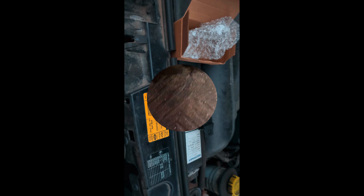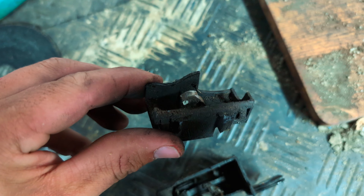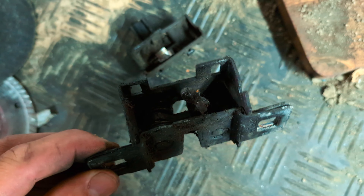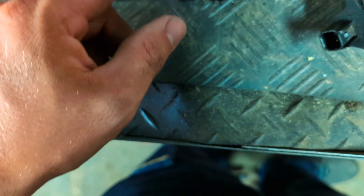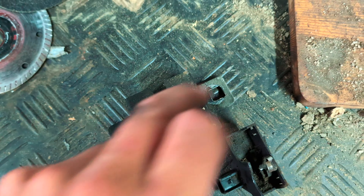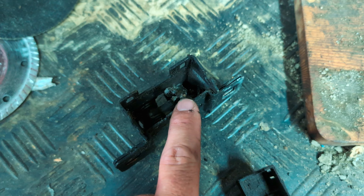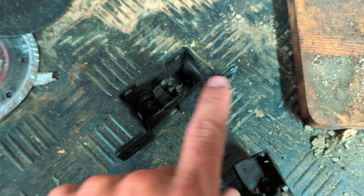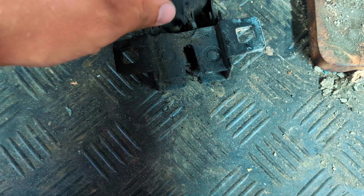Nice quick simple video. The switch fell apart in my hand as I took it apart, so there's no problem there. It literally is just as simple as undoing those two Torx bits, flipping over the cable — it literally just flicks out of there and out of there. New cable in, new bit in, plug your sensor back in.